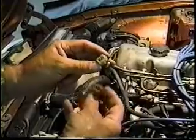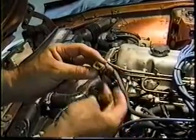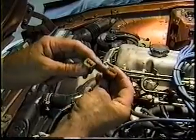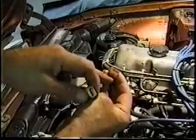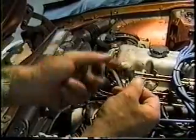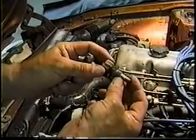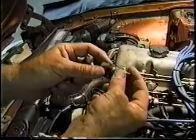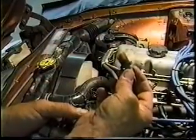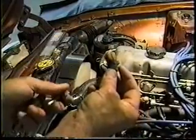These generally don't give a whole lot of trouble. I wouldn't look for this to be a big trouble area, but bad contacts here can mean a world of problems. This one is rusted and corroded and has turned green from water leakage — the thermostat housing had been leaking from where the thermostat had been improperly replaced. A lot of fuel injection problems come from sloppy maintenance of cooling systems where water drips down, corrodes these contacts, and that ends this little guy right here — the brains of the whole outfit.